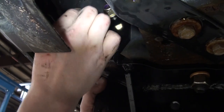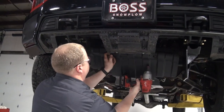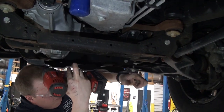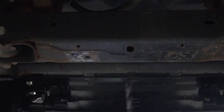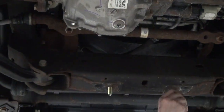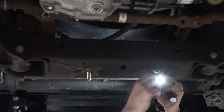Repeat the side plate install process on the other side. Remove the front plastic skid plate and mid-mounted metal skid plate. Using a 9/16ths drill bit, drill out the threaded skid plate holes on the transmission crossmember. Thread a half-inch bolt and flat washer onto a bolt puller and insert it through the access hole on the top of the crossmember through the previously drilled holes.